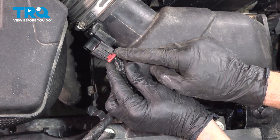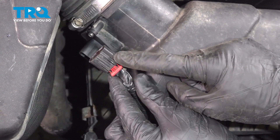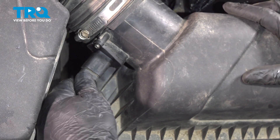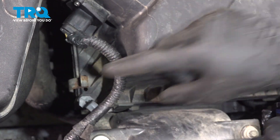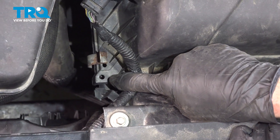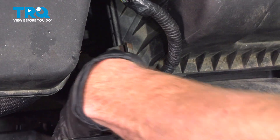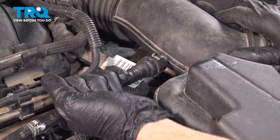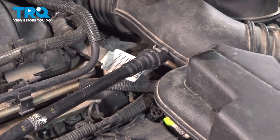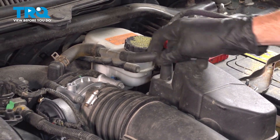Press the box down as far as you can and lock it in with your two locking tabs. Now we can reconnect the mass airflow sensor. Once you press it in, make sure you lock it in with the red locking tab — press that all the way inward. Re-secure the wiring harness to the corner of the air filter housing. Follow that air inlet tube, reconnect this line, give it a click and a tug to make sure that's secure. Continue following it up, reconnect this hose, press it in, and make sure that's secure.